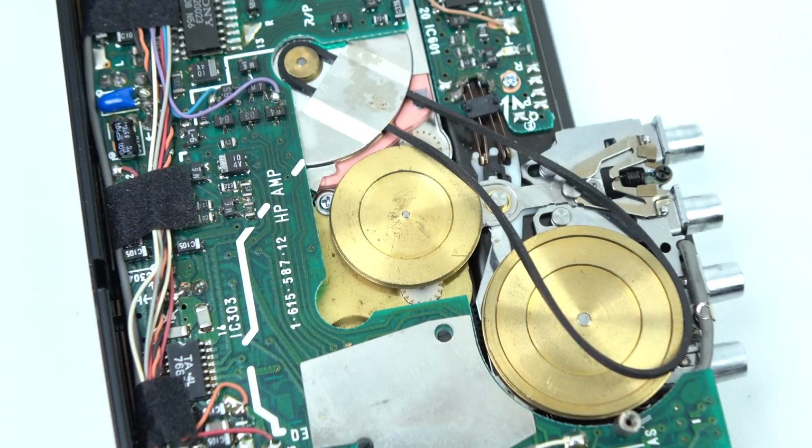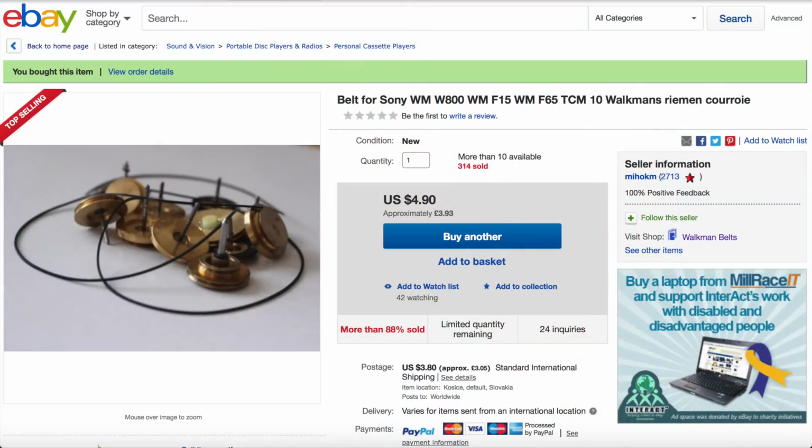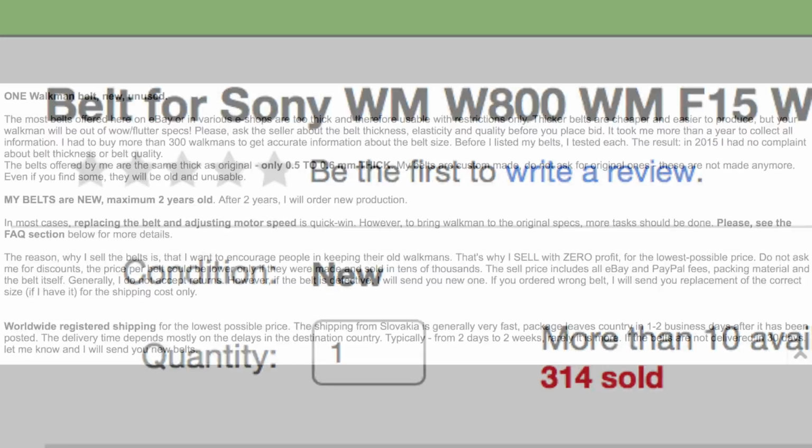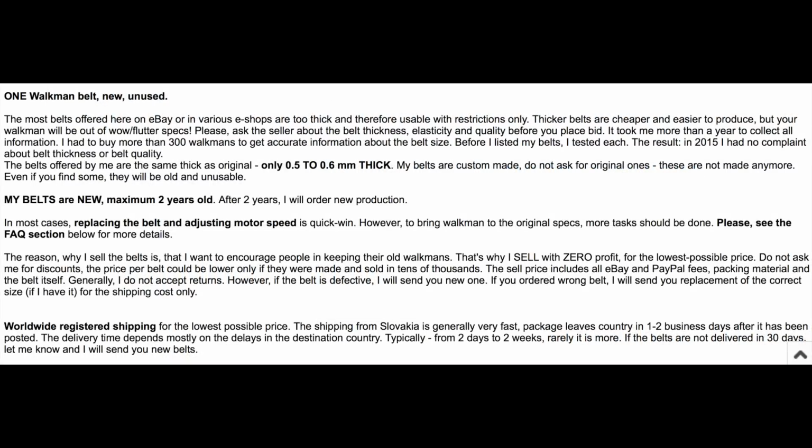I then went back to eBay to try and find some more. Unfortunately, there's one chap in the world who can help me. He's known as Doctor Walkman, I believe, on the Walkman forums, but on eBay goes by a different name. However, he's the guy who can supply the belts I need. He's got a load of different auctions for all different machines. He even mentions a machine that I've got, the W800, so I know I'm getting the right size. And as opposed to the 1 millimetre thickness belts that you can get easily in the UK, his custom-made ones, you can see there, are only 0.5 to 0.6 millimetres.